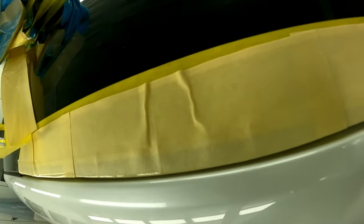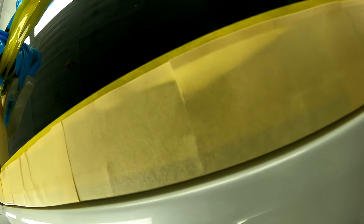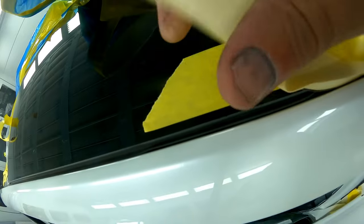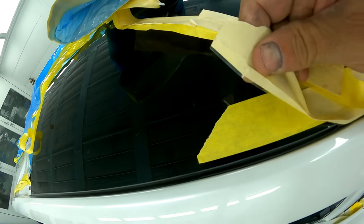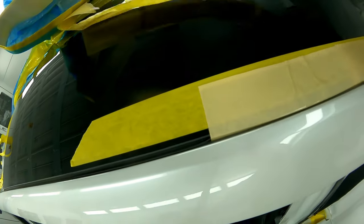You can see the fold tape did a good job — it held up and it's a good quality product that did what it needed to. You guys can see it pulled that rubber back enough to paint this without any problems. For any of you guys who are new to painting, it's got a little clear plastic that slides down and holds back the molding so that you can paint something with the glass still in it.